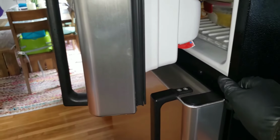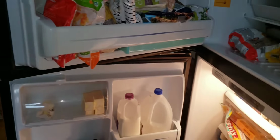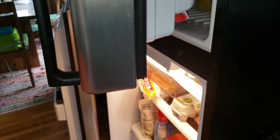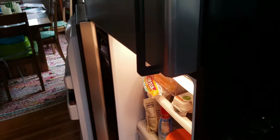This should have an anti-open hinge in which the door will automatically swing either in an open position or in a closed position. Could be applied weight that causes the door not to shut on its own. Or it could be food storage hitting the rails and racks and preventing the door from shutting.